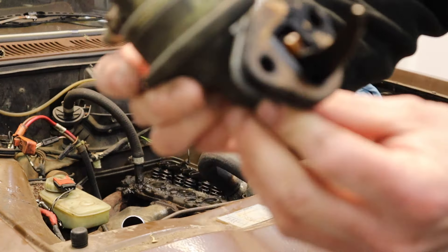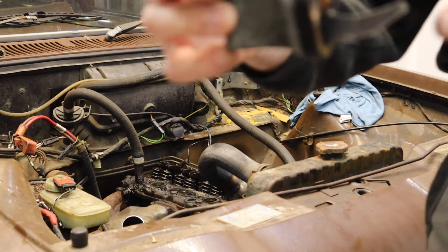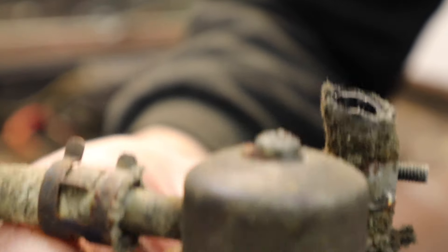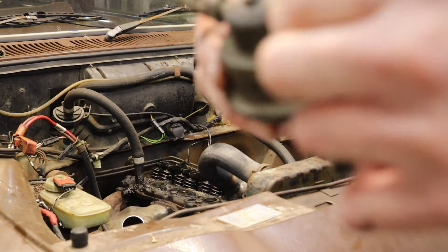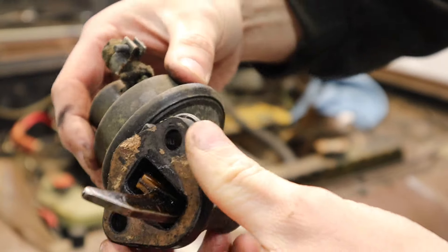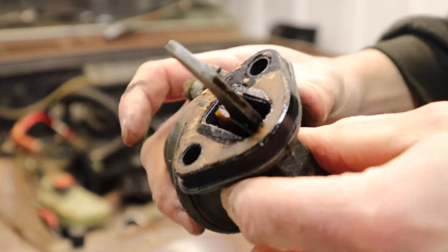That's the mechanical pump off. It will sit on the camshaft, and there'll be a lug on it that rotates. That creates a vacuum and draws the fuel up from the tank. The O-ring on the top's broke. It's really crusty inside, but we can work with that. We can rebuild that, get that back on, painted up, freshened up.